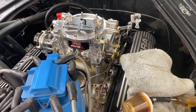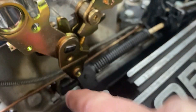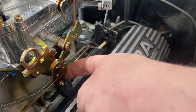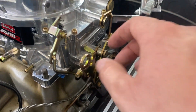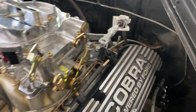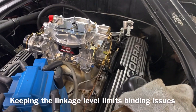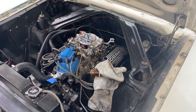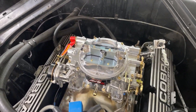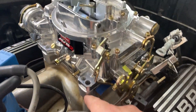I'm just making a test run because inevitably you'll probably have to go to the parts store. What I noticed is the TV cable lines up pretty well with the hole, but when you put it on this side and you try to rotate it, it hits the valve cover. If I flip it and put it on the other side, there's a little piece on the back of the linkage that doesn't let it rotate. So I've got an old one-inch spacer — I'm going to try and put that on there to lift it up and see if that will allow it to move the way it should. I may need to get some little tiny spacers to bring that whole bracket up so it's in a straight line. I did read that these 302 Fords like to run a little higher fuel pressure, so I may pick up a fuel pressure regulator while I'm at the store, just a cheapo, and a new fuel filter, some more fuel line hose — just little odds and ends. So we're going to test fit everything, make our list, run to the store, grab it, and get it all together. I put the carb spacer on — I need longer studs, but that does fix the issue.